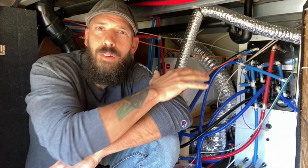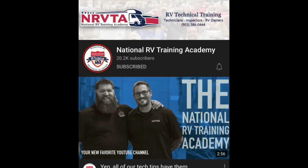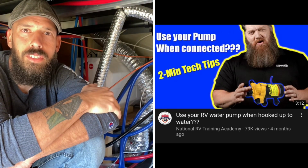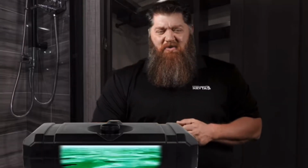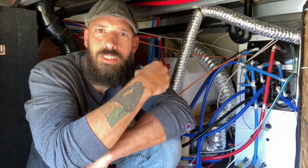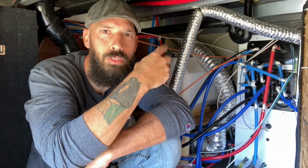Oddly enough, I just recently saw a video from, I believe, Todd Henson, and he runs one of the national RV tech schools down in Texas. He had a video explaining this, how even if you're on city connections all the time, every once in a while, it's good to fill up your fresh water tank and use your pump. The best thing that we can do is actually exercise our water pump. Run your pump for a while, a few days, and just keep it used. Just naturally, you want to keep that cycle of using it every once in a while.